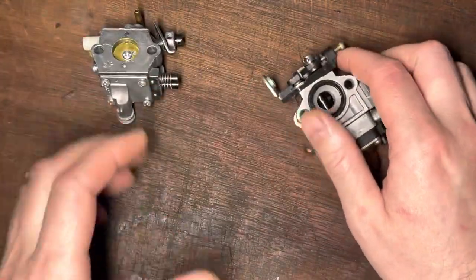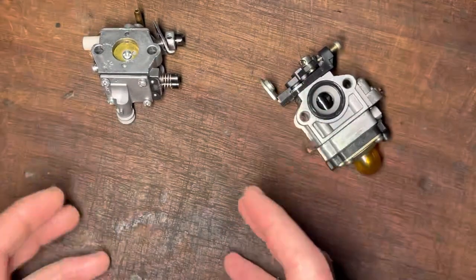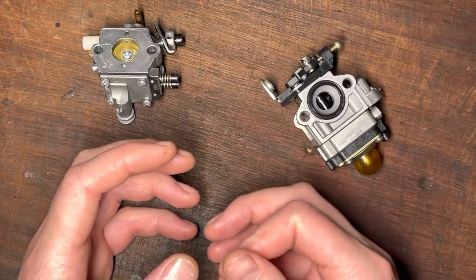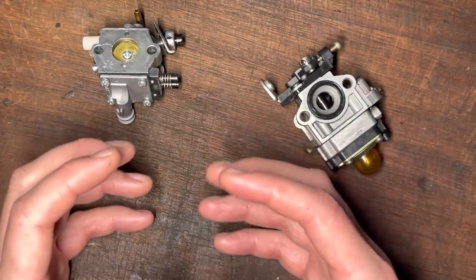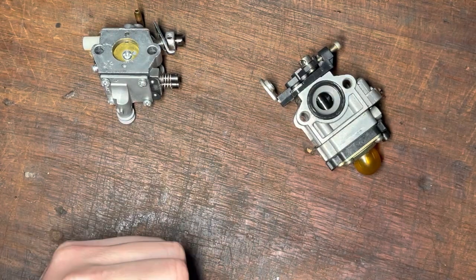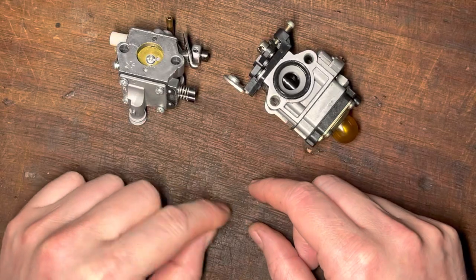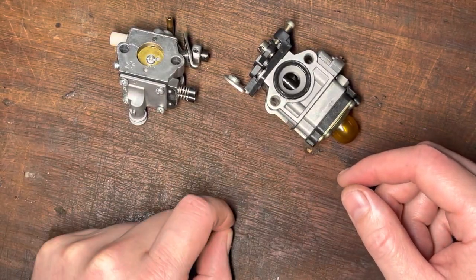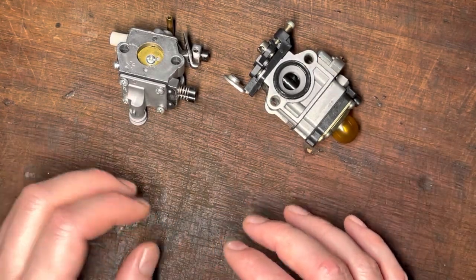What's more likely happening is that when a two-stroke engine is idling, it's very inefficient at transferring fuel from the carburetor to the top of the cylinder where the piston needs to combust it. There are areas within the engine and the manifold where fuel likes to pool — basically little puddles of fuel — most commonly in the intake manifold or crankcase.